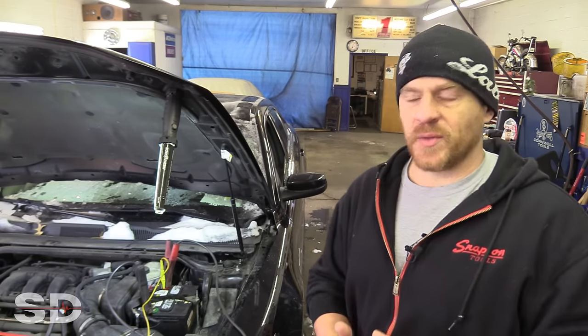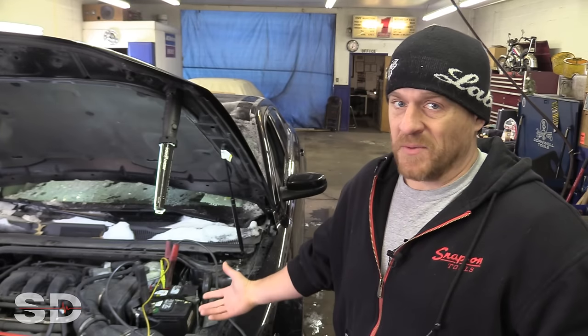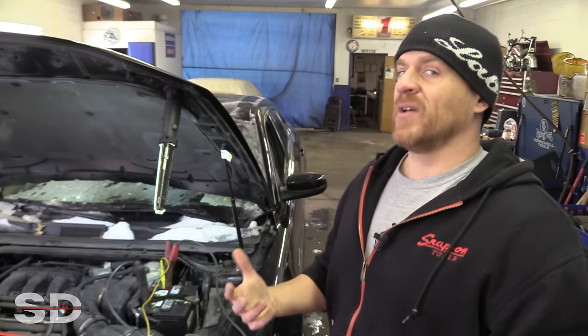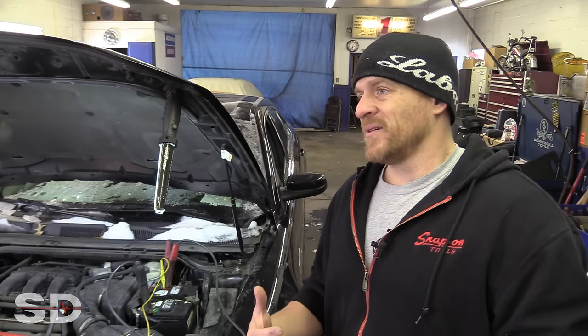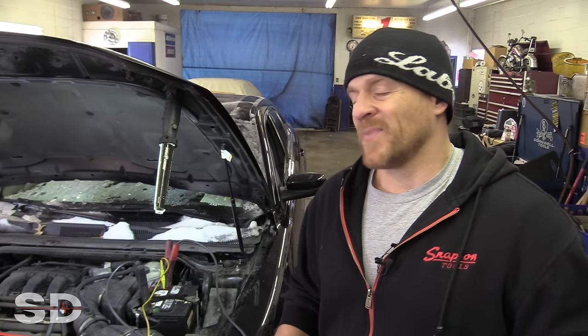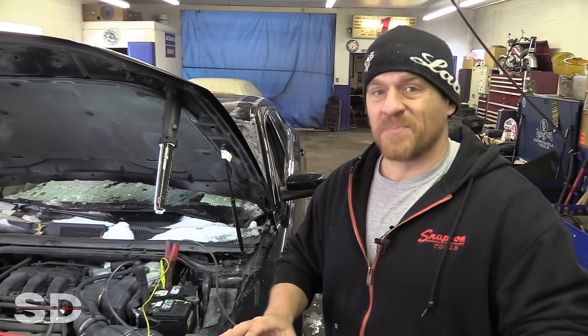While we're here, this car could simply have a bad battery causing the intermittent no crank. However, that doesn't explain the continuing to crank symptom. Let me show you a quick test: given that this battery was dead, the procedure is a three-minute high charge test using a battery charger on a 100 or 200 amp start mode for three minutes. We want to make sure voltage does not go over 16 volts. If it stays under 16, the battery is absorbing — it's like an electrical sponge — suggesting the battery is still good. If it immediately spikes over 16 volts, stop charging it — it's bad, replace it.